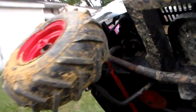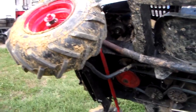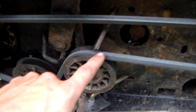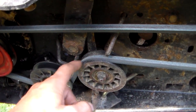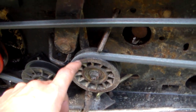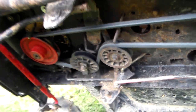I set this up so all I gotta do is undo five bolts and this whole front axle beam drops right out — easy to replace, that's the way I designed it. What took me out was the first time ever I've had my belt jump off this idler pulley. Everywhere else the belt stayed on, but it jumped off this pulley right here on that one big hit with Patrick. I'm going to have to throw some extra belt guards over this to help fix that — should be able to throw a bolt at an angle to cap it in a little more.